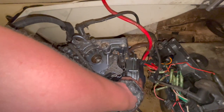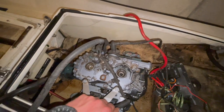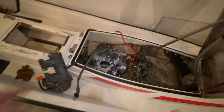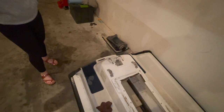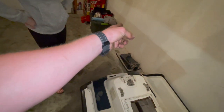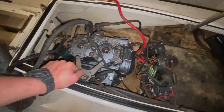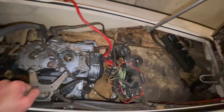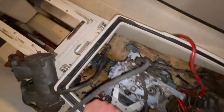We got to tighten these down, and what else do we have to do? Got to clean up this surface, but just a couple things, and then we'll put the shims back in and bolt this back down once we get the fuel system all back together. Put the new gaskets on, new plugs in. What else do we have to do? Yeah, hook up the lines, and then close up that fuse box, drain out this disgusting fuel tank, and put some premix in this sucker.